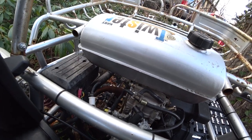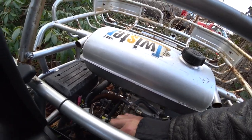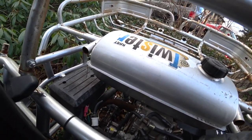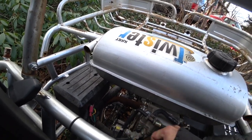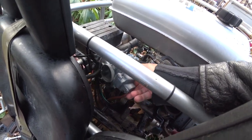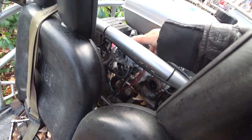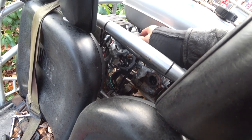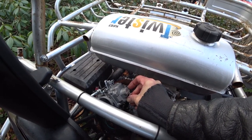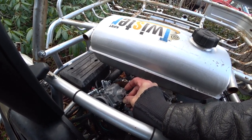Now what I'm going to try to do is just kind of yank off the carb. Let's see if I can't leave a lot of this stuff on here while I work on it. Oh, come on — I felt it go. There we are. It's going to pour a little gas out — that's okay. So now I just have to take out these four Phillips screws. Then I should be able to pop off the bowl and have a look at what's inside this thing. Maybe two months is enough these days with this crappy oxygenated gas they've given us.